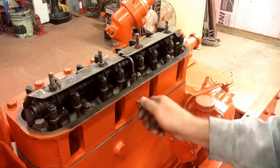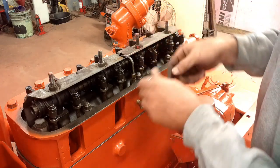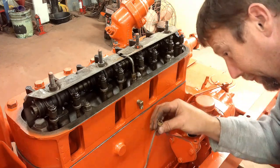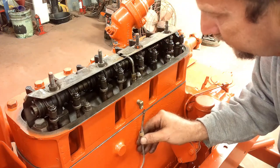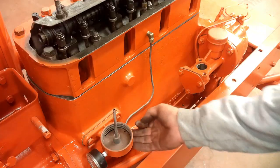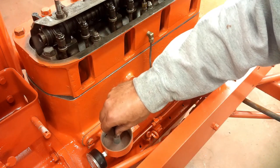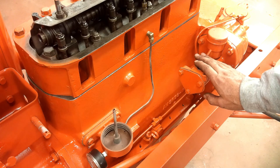Then the oil can just drain back down alongside the pushrods. To get oil up to that fitting, there's a line that comes from the filter housing up — that's what comes up and feeds this. The oil lines are all routed. I'll get my little brush and touch that up with paint. The oil pressure gauge is installed. I need to install a new oil filter, which I haven't got yet, and I'll need to get the distributor installed — which I think I'll do in the next video.